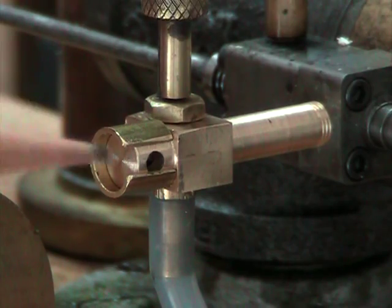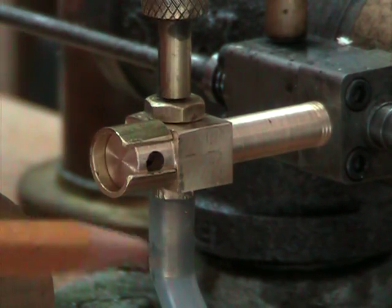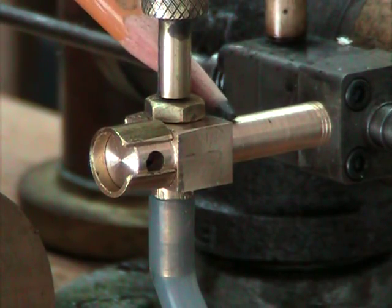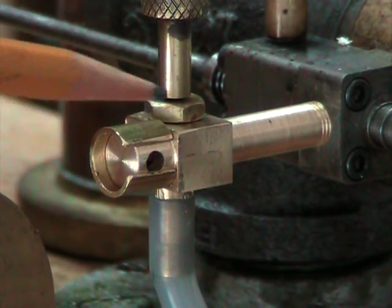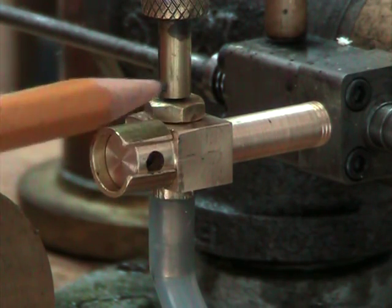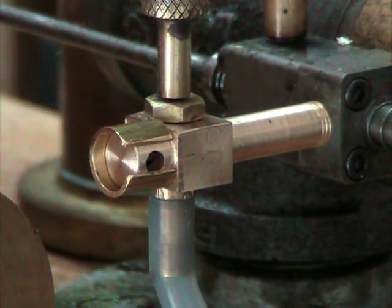What you can't see from this: this tube goes through and is an interference fit into the venturi on the carburetor. There's a hole on this side of the tube that extends into the venturi, and the air going across it pulls fuel into the venturi and then into the engine.